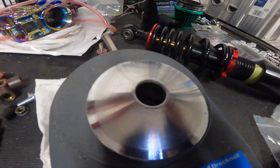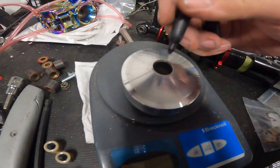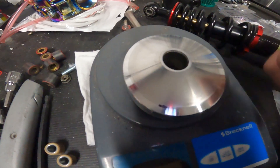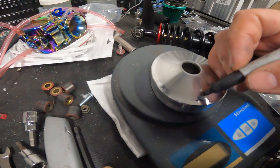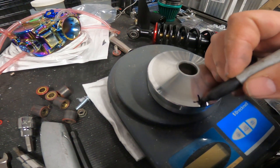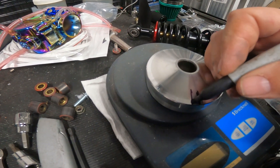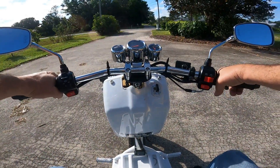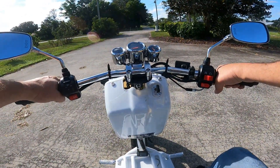The belt does not appear to be going all the way to the outside of the variator — you can see the line is stopping short. So I'm not really traveling out there. I might try heavier rollers to see what happens. I'm going to go up a little bit from the 5g stock — I'm going to go to 6.3g rollers.